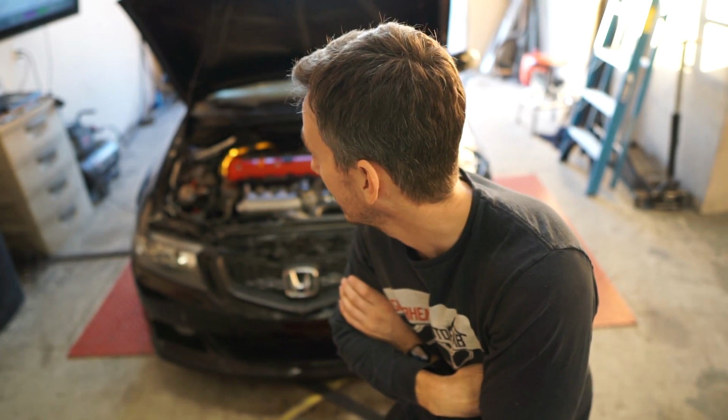Okay, so Emerson's car is back on the dyno. He upgraded the turbo from a small little Garrett to a 6262 Precision. And first pull, we beat the last turbo's horsepower at like, I think it was 14 or 15, maybe 16 PSI, something like that. Not a shock. So the last pull made 401 horsepower, very, very rich, very, very retarded in timing.